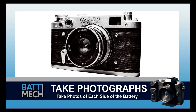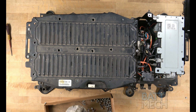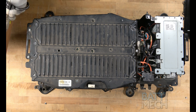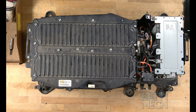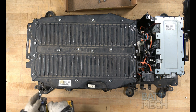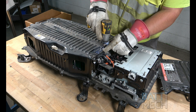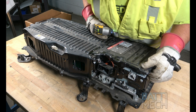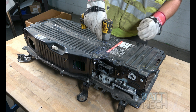Now's a good time to take a photograph of each side of the battery. These photographs can be used for review of assembly if you experience issues, and may save you from having to uninstall the entire battery later. Now that the wiring harness reassembly is finished, go ahead and place the main metal battery module cover back on, using the same screws you removed. If you accidentally put the four screws on before attaching the metal component cover, go ahead and remove those four screws, put the metal component cover in place, and attach it using the four removed screws.